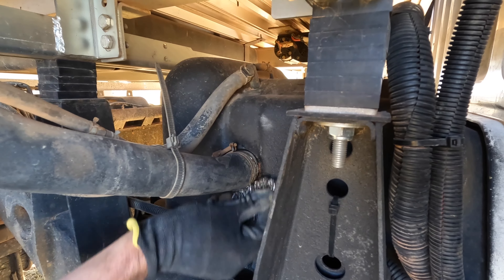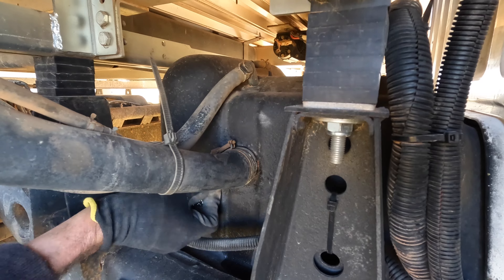Big job number one is I have rust somewhere in my fuel system because I have found it in my pre-filter. I've been swapping out my filters more regularly so it doesn't get in my fuel pump and become catastrophic. I'm giving this a good clean around the fuel neck so we don't get any dirt fall back into the tank and we take the neck off.